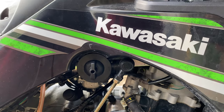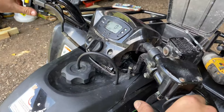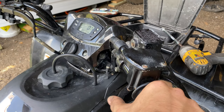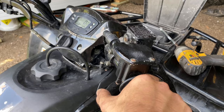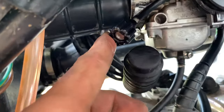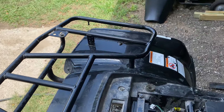Go ahead and try to fire it up — turn the key on. Make sure your choke and your throttle are working smoothly before you try to fire it so it doesn't try to run away on you, and make sure it's in neutral of course. There we go — that was no choke and it's running perfectly! You might have to come down and adjust your idle; the screw will be right there or it'll be a flathead on the side of the carburetor. But that'll be it for this one — thank y'all for watching, y'all have a good day!